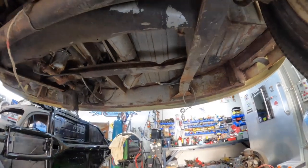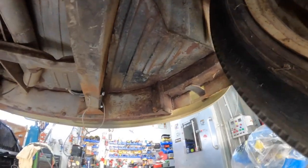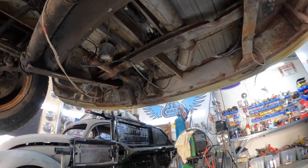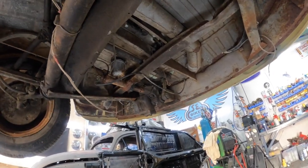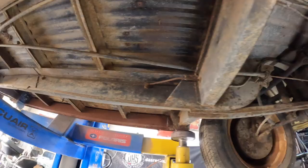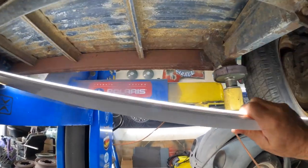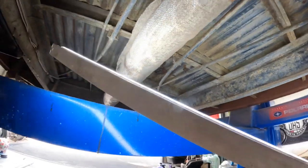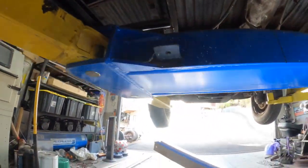There's a little repair we're going to have to do here — this thing's had a wallop. There's a little bit of surface rust underneath and all these mechanical parts just need to be cleaned and looked at. That master cylinder looks toast — it'll definitely have to be replaced. The rest of the chassis has some surface rust, but you can see the jacking point has been replaced and the chassis rails look perfect. There are a few little repairs I can see. That's the step — we can unbolt that, take it off, and restore it.